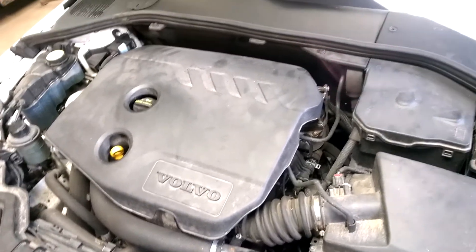I have the oil in now and I'm just about to dip it. You can see on the dipstick that it's right up to the maximum line, which is a good position to be. I'll re-dip after I start and run the engine for a little bit, then top it up a bit more to make sure the level is fine.